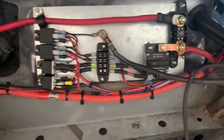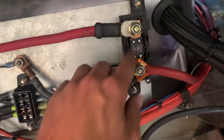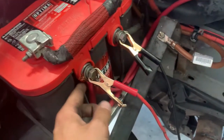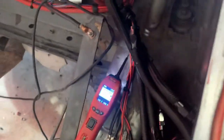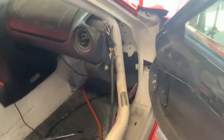Lots of progress — majority of the wiring is finished. I don't have any fuses in this, I just have paper clips, but they'll still get the job done. I'm missing the terminals for the wiring so I just have it clamped to the bare wire right here just for testing purposes. Same thing over here — I have everything pretty much how it's going to be. I just need the copper lugs. We're going to test the voltage with my power probe just to make sure the battery is putting out 14 volts and the chassis is grounded pretty much everywhere. Same thing up in the engine bay. Let's give it a shot.